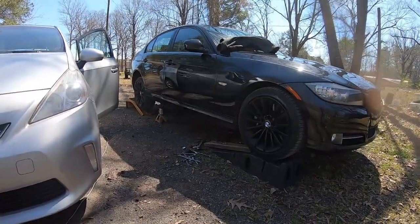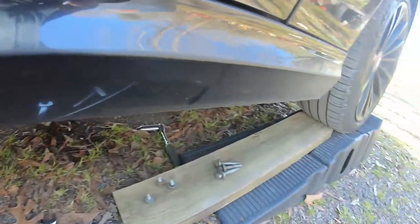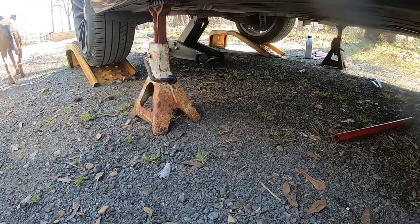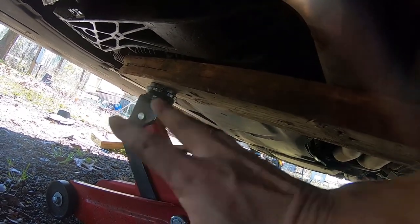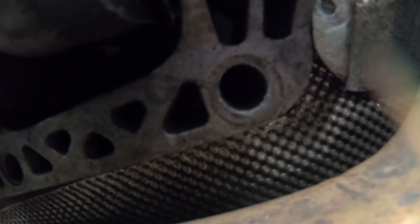You want the car level, and I've got it basically level. I have jack stands holding it up in front, ramps up front, and the jack in the rear just for peace of mind. Now underneath here, you'll have three bolts on one side, then two bolts — one there, one there — and this one here. Those bracket bolts are all 13 millimeters, and that larger one is 19 millimeter. Let me get those off and show you what we're doing.